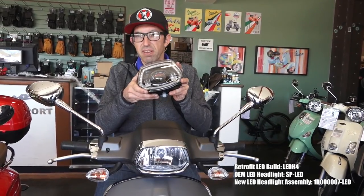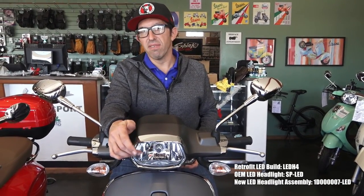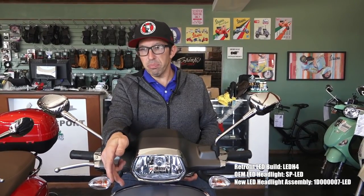Alternatively, if you're looking for something less expensive, we do have the OEM original Vespa LED headlight kit for the Sprint. In Europe, 2018 and later, they've come with the LED headlight; for North America, no LED headlight, but we have the kit to convert that over. If you're looking for something even cheaper but want the cool white LED and a slightly brighter headlight, you can alternatively put in the LED retrofit bulb — we have videos for that, it's a real simple install, essentially replacing the bulb with an LED module.